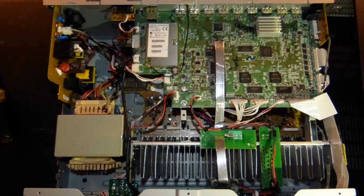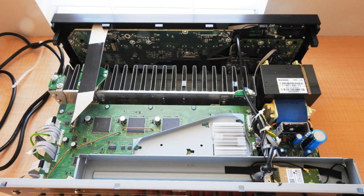I want to answer this question as best I can. I don't want to deal in absolutes, because as you know, only Sith Lords deal in absolutes. But a general rule of thumb: if you buy a really stout receiver — which is hard to find these days unless you get the flagship models — you're kind of wasting your time with bi-amping. If you're buying an entry-level $500 or $600 receiver with seven channels and only using five, I would not use the bi-amp feature. Here's a Yamaha that was about $1,000 at the time — it did not have a very good amp section, the power supply was not capable of driving four-ohm loads. In that case, don't use the bi-amp feature.